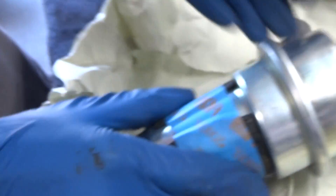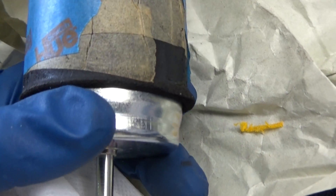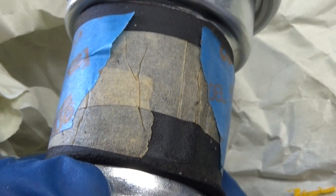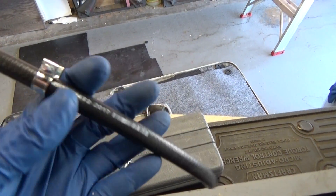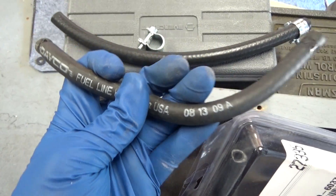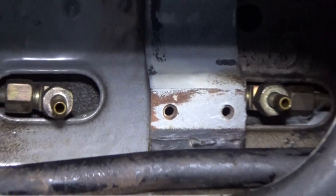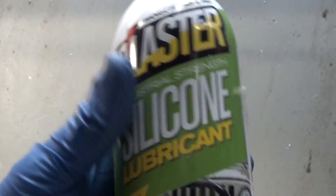Reconnect the pad — if you don't have a new one, you can use some masking tape. This pad is so the accumulator does not move around; it acts as a barrier between the bracket and the accumulator body. Next, start prepping your new hoses. The smaller hose goes onto the back of the accumulator and connects to the return line — use the smaller hose clamps, one on each end. Use the old hose to estimate how much new hose you'll need. Before installing, make sure all connections are as clean as possible. If you have some silicone lubricant, that'll make it a lot easier to slip the hoses over the barbed ends.